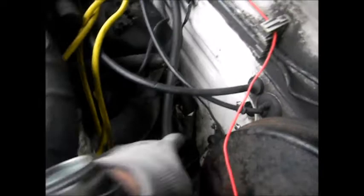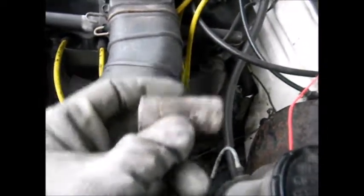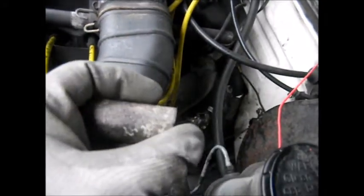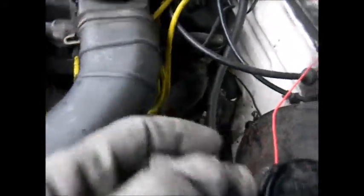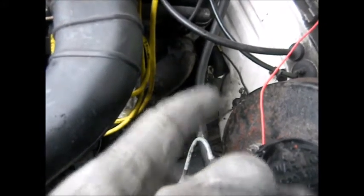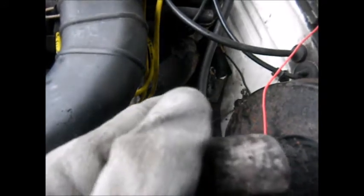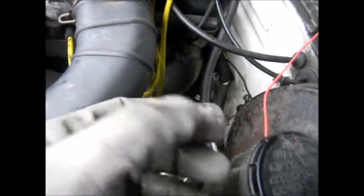I've also got a heater tube back here, so I had to put a shield over that heater tube. Because initially when I had the sleeve over it, it would blow out the sides and heat up that radiator tube — and it blew it out. Luckily I didn't have too far to go, but I was watching my heat gauge go up on the freeway.